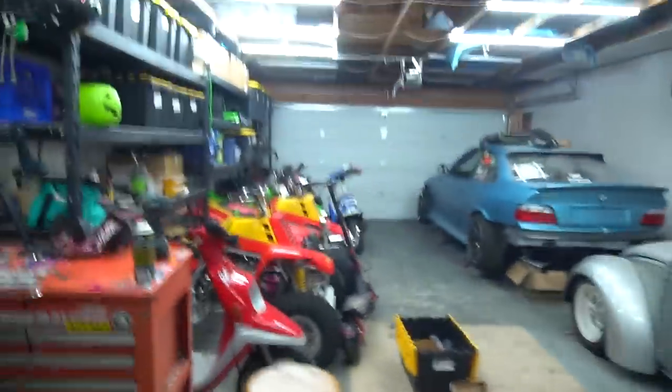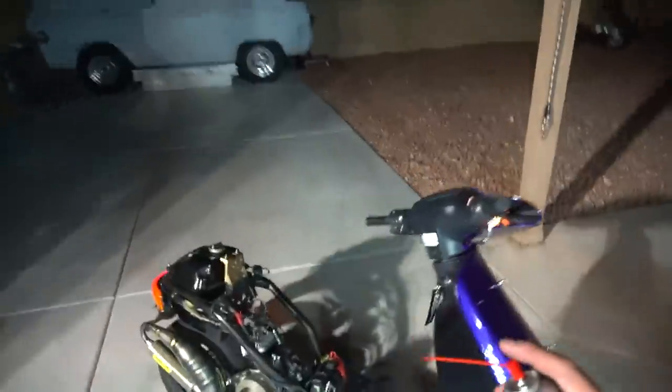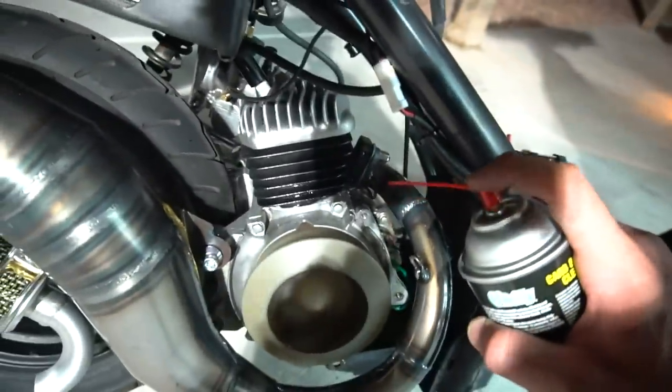We got the tach working. I got it chilling right now, about 1400, 1300. I'm letting it warm up. We're looking at 160 right now. Don't have the cooling shrouds on because I'm going to spray a little bit of this, even though it's on the gasket maker we put. But I just want to make sure we don't have air leaks. We don't have any exhaust leaks, thankfully. And I still need the other spring.